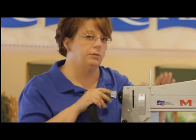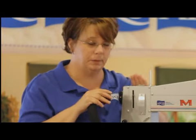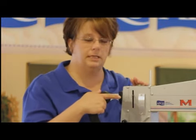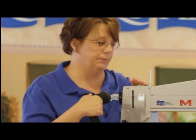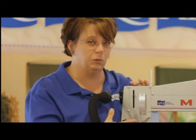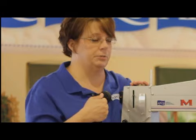When the machines are brand new, the belts are tight, the gears are tight, and it's really hard for the machine to complete that positioning function. So we set the circuit boards to give the motor enough power to position your needle the way it's supposed to. As the machine breaks in, it gets easier for the machine to move, but the motor is still getting all that power — that's how we get our Energizer Bunny.